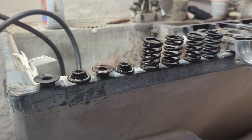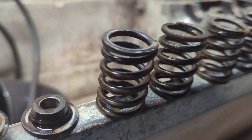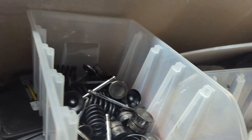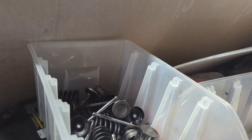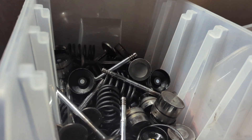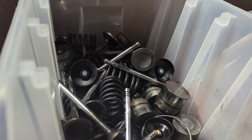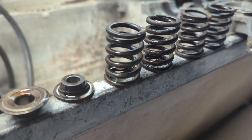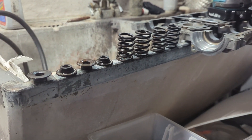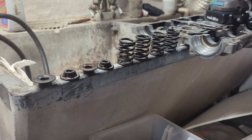I'm cleaning the internal parts of the cylinder head. Some have been cleaned, some haven't. There's some sludge buildup — I've never seen it before in a Volvo head. I'm suspecting the car started consuming oil and they put something in the oil to slow down consumption, which started creating sludge. Some are cleaned off, and that'll probably make the first few oil changes kind of dirty.